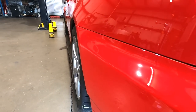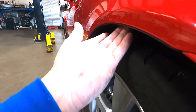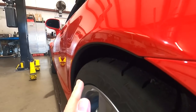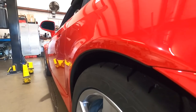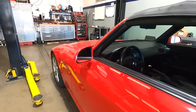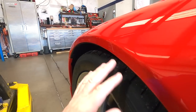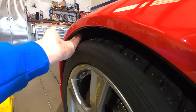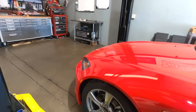It's a little bit more of a beefy look now. It doesn't really need to come out anymore, and we can keep the mud flap rubbers right here - these are still in perfect shape. If you start coming out anymore or lower you're going to start running into those, which you can remove for a little bit more room. But with this thing being so mint I almost don't want to do that. There's more room in the front which is why some people go 20 millimeter on the front, but then you run into this tab right here. As nice as this car is, I almost don't want to run the spacers.